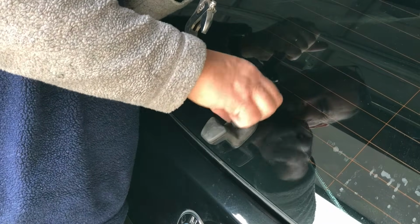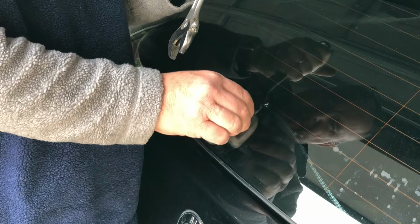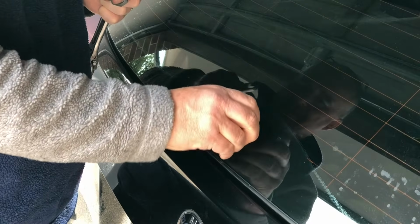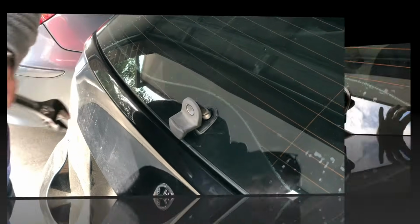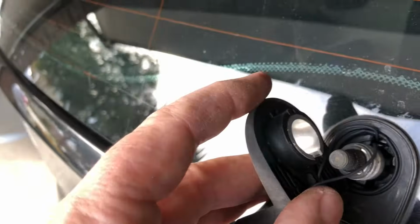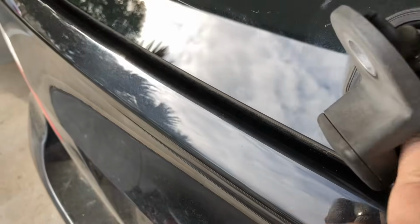But I've certainly seen that by this being wet can short out the switch and cause problems. So little nylon washer, a nut, take that off. Yep, here we go. Switch comes up with 2 wires. So what is under there is these 2 wires running through to the switch there. Now this is an area I've seen people playing with and saying it can't get wet and so forth. And now I've got no moisture here.